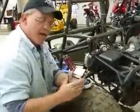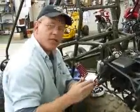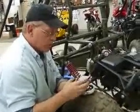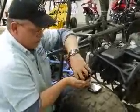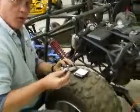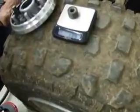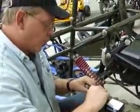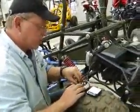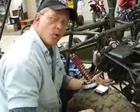We've got a handy little pocket scale — got it from Northern Tools or Harbor Freight for about 15 bucks — it measures in grams. We take out one of the rollers and it reads 13.9, so that's probably a 14-gram roller since they're worn. So if we've got 14-gram rollers in there now, we're going to drop down to a 12-gram roller, and that should produce a noticeable increase in low-end torque.